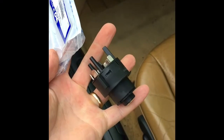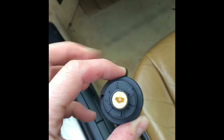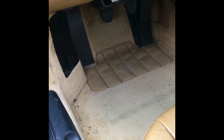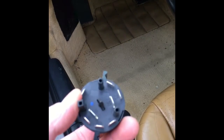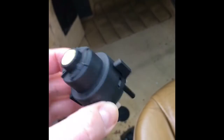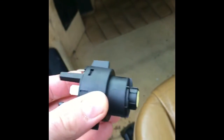I got the part here from Pelican Parts. I think it's actually an Audi part number, but this is the electrical back end of the ignition switch. I'm going to crawl under there, pull out some heater ducting, and hopefully it comes out with two Phillips head screws — should be a pretty easy fix, but that's usually the famous last words, so we'll see how it goes.